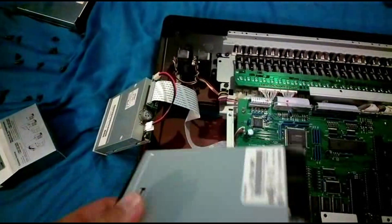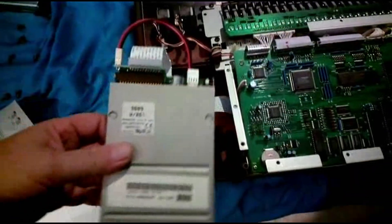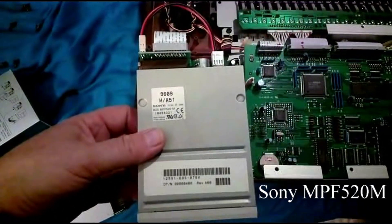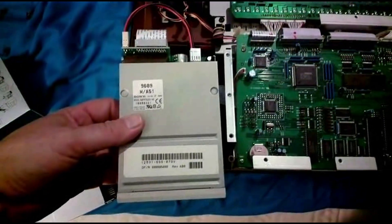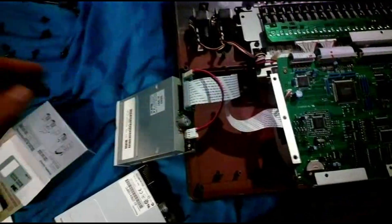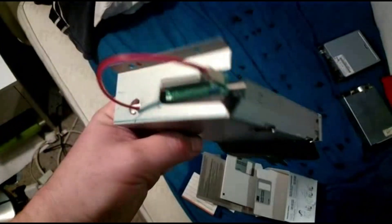We might have to modify the piece of metal. Bad disc — that's not a good start. Panasonic drive JU256A 198 PC — there's either a fault with this drive or it's just not compatible. I've pulled an old Sony drive out of a PC which I think is one of the recommended ones — it's an MPF520M. I've formatted the disc and loaded one of the factory discs, so I'll just try and see how it will fit in.